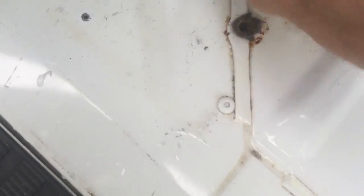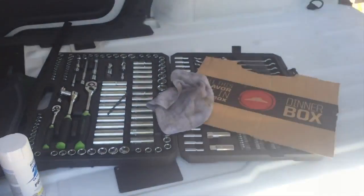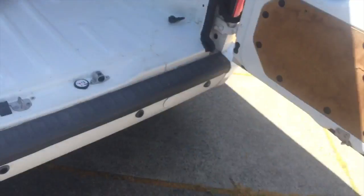Next thing I did was fill in the holes. It was super jagged and I was having a really hard time straightening it out - it's after all a dime-sized hole. What I did was sand it about an inch in diameter around it. Then I put Bondo over it, waited for the Bondo to cure overnight, sanded it, and spray painted it. Now it's looking a hundred times better than it did.